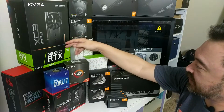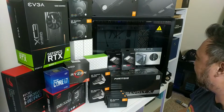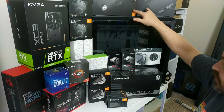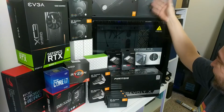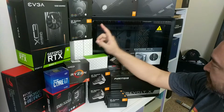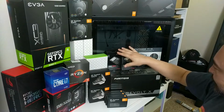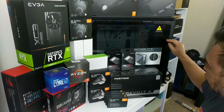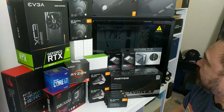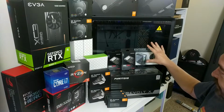And for the green, the big G, the 3080 Ti from EVGA, I'm probably going to mount that vertically with the 2 water blocks. I have the GPU block and the active cooling plate. That in itself could be overkill, but I have to take the hybrid cooler off and install that, and I'm going to mount it vertically, and that's going to get coupled with the other 360 rad that's mounted up front with another FTL120 reservoir from EK. So that will be another separate independent loop.